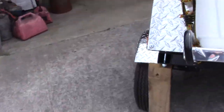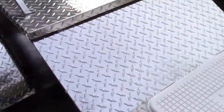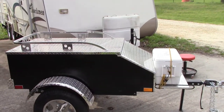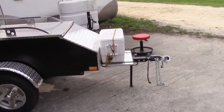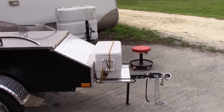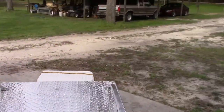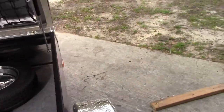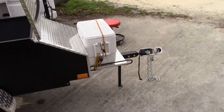And that's as simple as it gets. You don't really have to do anything else to shorten the tongue. When I first put it together and put the trailer behind my Gold Wing, this thing stuck way back there and I didn't like that. So I shortened the tongue without having to cut anything — all I did was drill three extra holes, slid it back, and bolted it together. It pulls great, there's not a problem with it. It's actually easier to park the dadgum thing. It was as long as a long bed pickup truck before, but taking 15 inches off that tongue made a big difference.